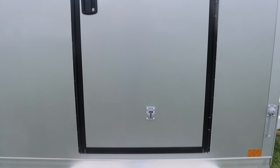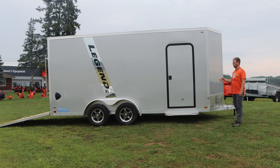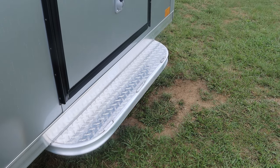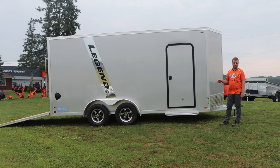On the other side we've got the RV side door — a 30 inch by 68 inch standard door with a nice RV-style latch, a deadbolt lock, and a handle lock, giving you a solid two-point lock. You can add a stainless cam bar for extra protection as an option. You can also go wider — 36 or 44 inches — or taller at 74 inches. We also add a fixed step on the side whenever we order trailers; the floor is about 16 inches off the ground, and the step breaks that up giving about a five inch difference.